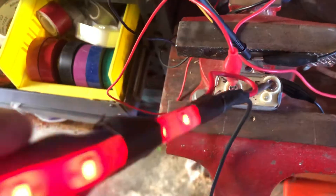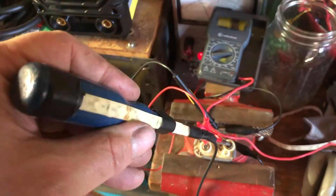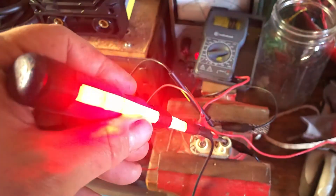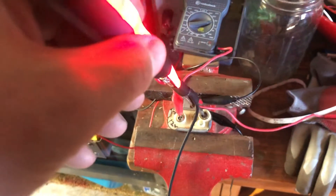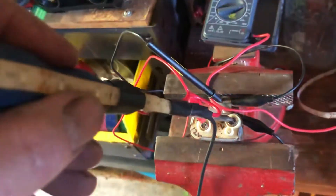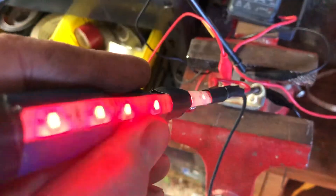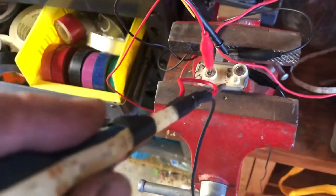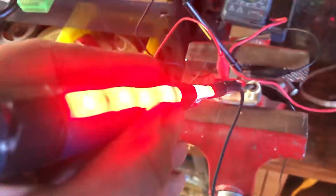Now on this other side it should be a nice, regular, non-erratic input. Give it a little tap. Not looking good. So there's an old 50-year-old mechanical part in there, so it's perfectly reasonable that it's not still behaving. That is the cause of our woes. When you have an erratic input voltage going into your sensors, your gauges are going to behave erratically as well.